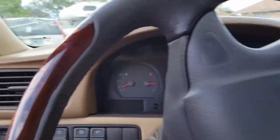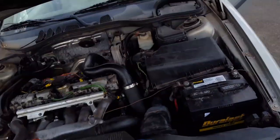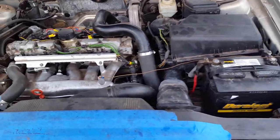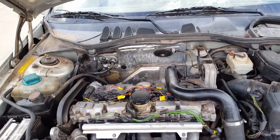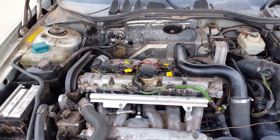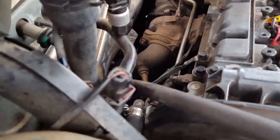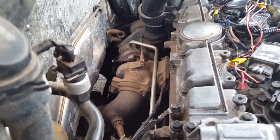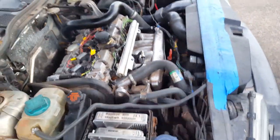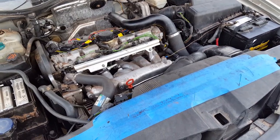Still amazing turning radius on these cars. Let's check out how much smoke there is under here. The previous owner mixed up all the wires for the spark plugs and added an extra ground wire. I did straighten out the coil pack wiring as to which goes where and made sure everything's good there. It's a bad miss — there's got to be a light for it sooner or later. By the way, there's blue tape here because there's still some fiberglass in those plastic panels, which makes my arms rather itchy.